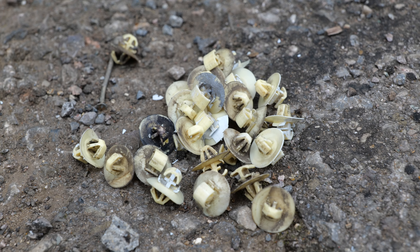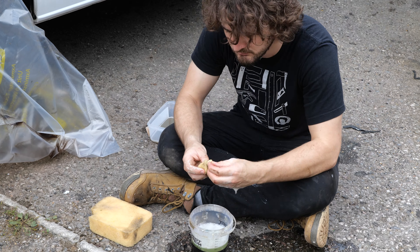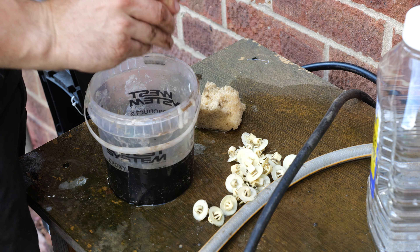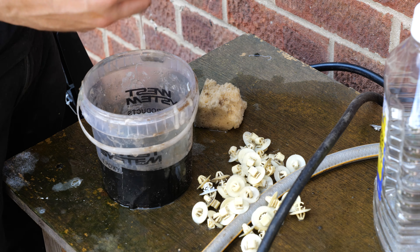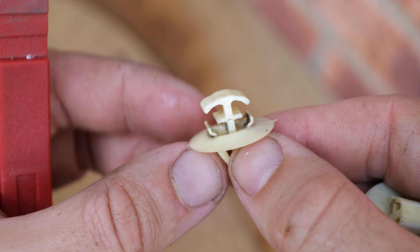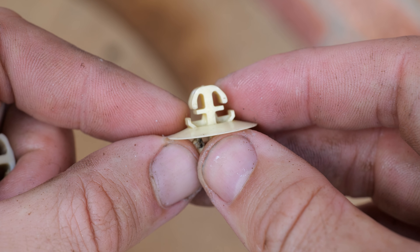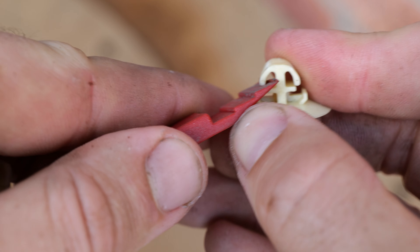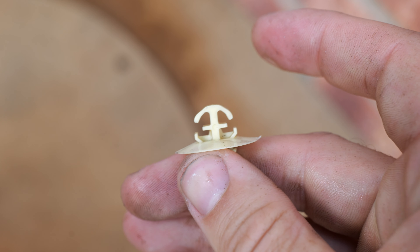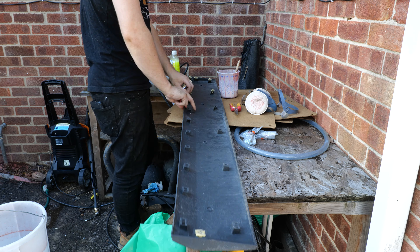The clips themselves were a little bit minging by this point, so it made sense to give them a scrub as well. I filled up a bucket of soapy water and cleaned them all off one by one to help provide a nice waterproof seal for the next stage. Before reinserting the clips, I found that while some held their shape well, on others the tabs at the top were compressed and wouldn't lock in place, so I used the trim tool to reshape them and make sure they'd snap in place nicely. Then I got them snapped back into position, ready to be sealed.